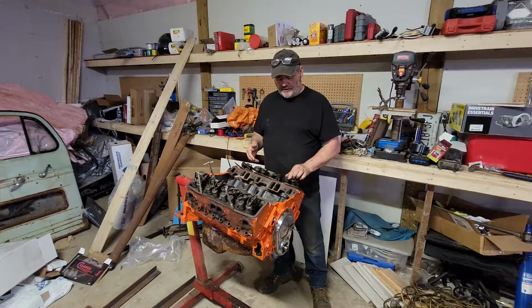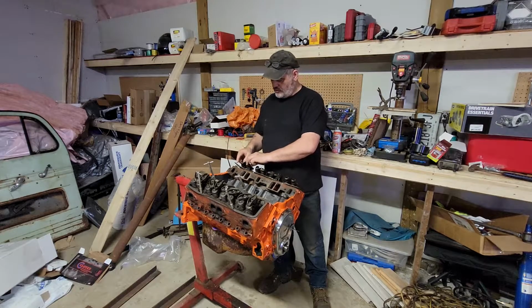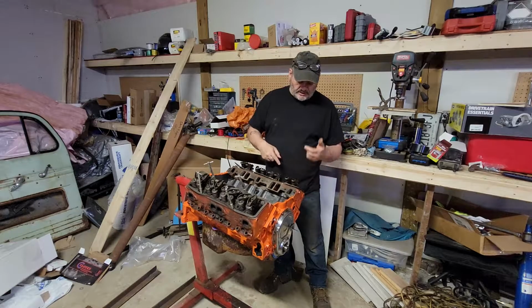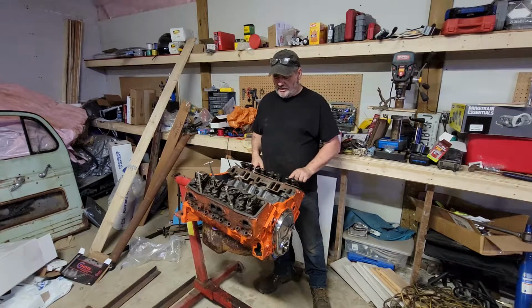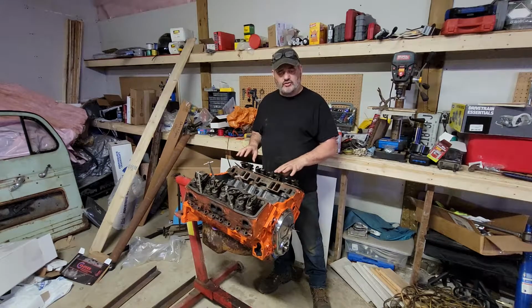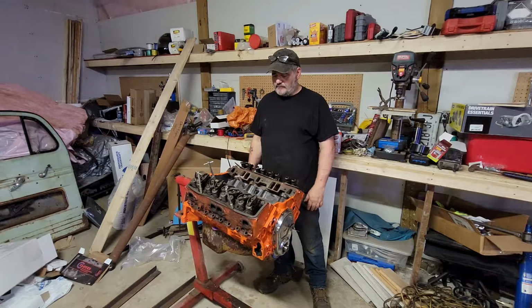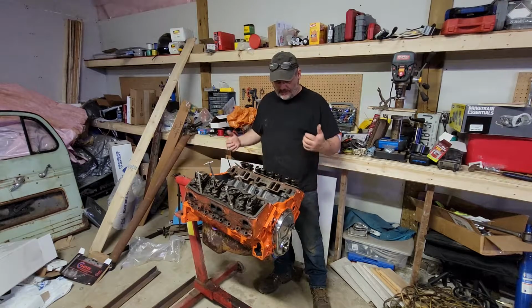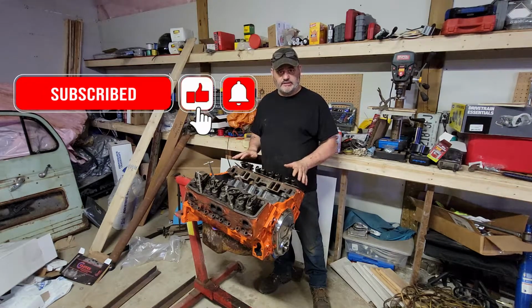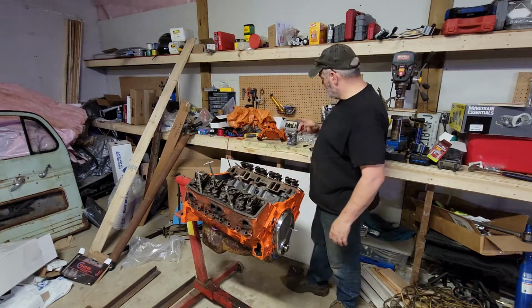And they're going on a different engine. They need to be cleaned up. They've been in storage for a few years. These have the screw-in studs, guide plates, upgraded springs, retainers, the works. These were last used on a dirt late model engine. Great heads, never gave us a problem, but like I said, I can't use them because I can't deal with that 64cc combustion chamber.